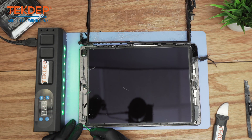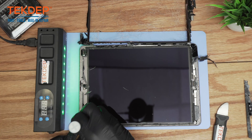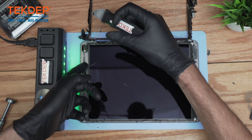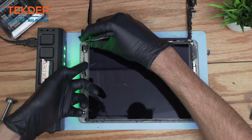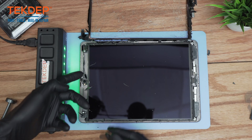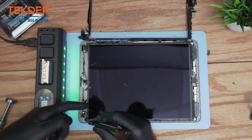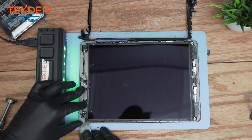Using the Phillips screws, we're going to take out all four screws holding the LCD. Once all of those screws are out, there's a little bit of adhesive in this corner and this corner. Do not take out the LCD from this side, otherwise you might cause damage — those are very fragile. Start your way from here.